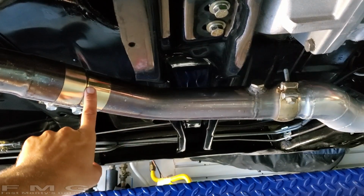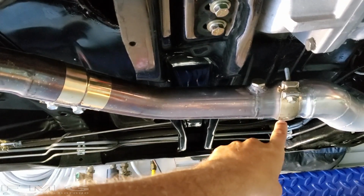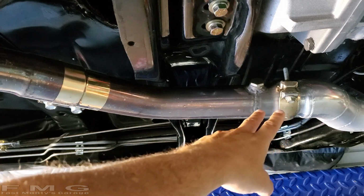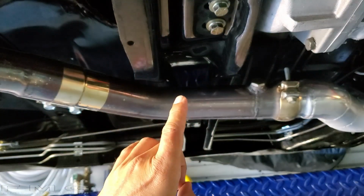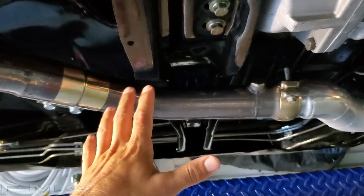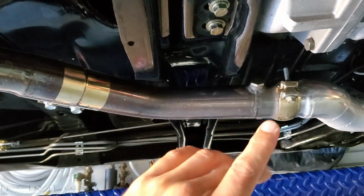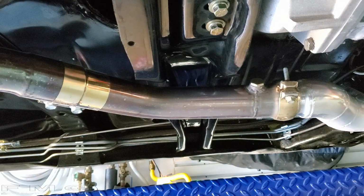Alright guys, so we have two connections here on each side, but I'm going to go ahead and turn the vacuum on, and then I'll start spraying these down with our water soap solution. And by the way, I misspoke earlier. You only need less than 5% soap, dish soap, the rest water. Okay, so sorry guys, I didn't mean to say 80-20. I just love that term. So I'm going to go ahead and turn it on, and we'll see what happens.